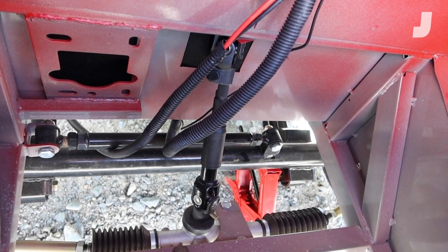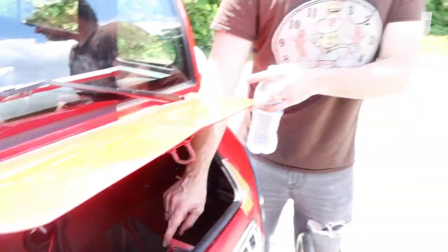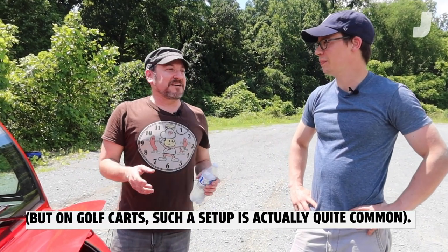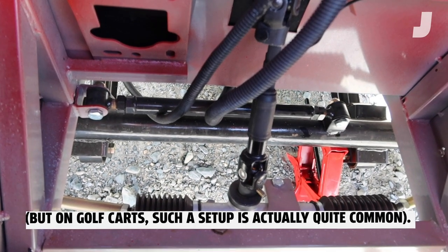Let's move to the side. But before we move outboard, I just want to point out — a rack and pinion steering setup on something like this is kind of amazing. The fact that it's got kingpins, and we'll look at that — kingpins and a rack and pinion setup. I cannot think of it, because kingpin is kind of archaic, old school. Rack and pinion is actually pretty modern; cars didn't start to have that regularly until the 80s. So the combination of kingpin and rack and pinion — I'm not sure another car in the world would have that particular combo. I agree.